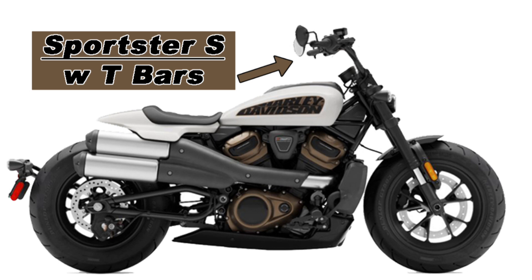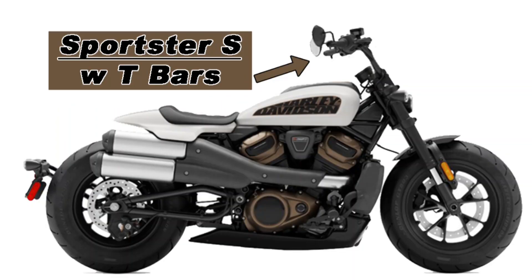So I've basically taken the stock handlebar and extended it straight up on the same trajectory as the front forks. I think that's what I'd like to see in handlebars. If you sit in a chair and lean forward and put your hands down on the desktop, then raise your hands up — keeping your back at the same angle — just three inches and tilt back a couple inches, that's four or five inches of change and it makes a significant difference in your posture. I think that would help this bike a lot. That's the bar setup we're going to stick with going forward in my concept, and people who run T-bars say they still have great control and feel of the bike.